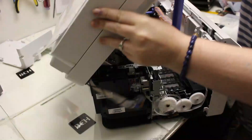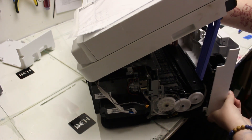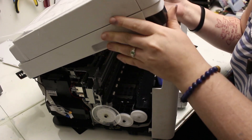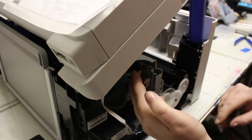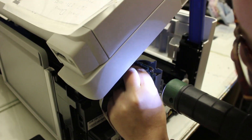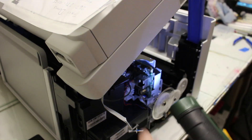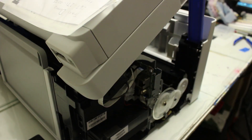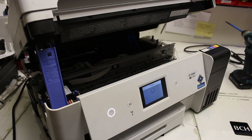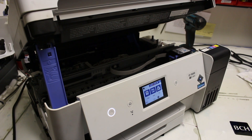To put the spring on, make sure that blue lever is facing towards you, and use your hand to stretch the spring on there, then push the lever back into locking position. Now I just need to stick on the scanner to test out and see if the FFC cables are in the right way with no error. Make sure your scanner fits onto both hinges in the back, then put in the blue scanner support by twisting it into place. To hook up the scanner, there's a small wire with a yellow cap that connects to a black connection on the main board, plus two FFC cables. I powered it on and the printer gave me no troubles — the FFC cables work! I hope you enjoyed this video; please visit us at BCH Technologies dot com or locally in Greensboro, North Carolina. Happy printing!